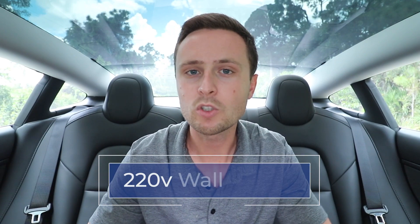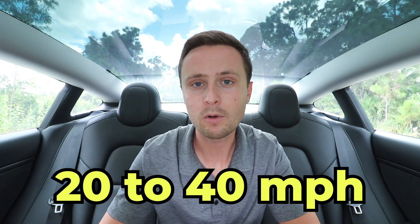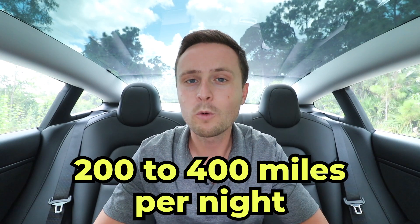The second main way to charge a Tesla is with a 220 volt wall outlet. You'll need either an existing outlet in your garage or pay an electrician to install one, which costs a couple hundred dollars. This is by far the best way to charge your Tesla — it charges a lot faster than the 110 volt outlet but not so fast that it harms the battery. The expected charge rate is anywhere between 20 and 40 miles per hour, meaning 10 hours overnight gives you 200 to 400 miles of range, essentially a full tank.